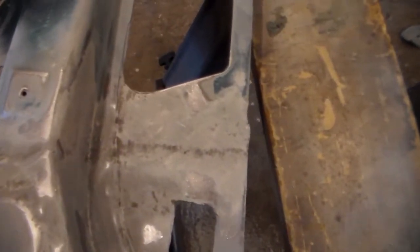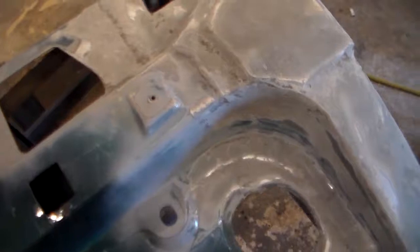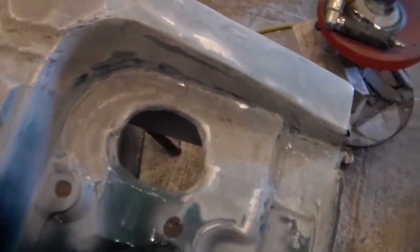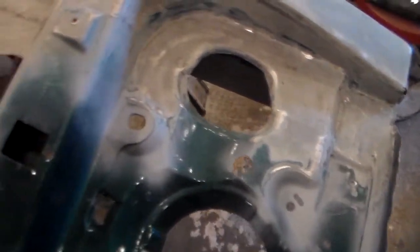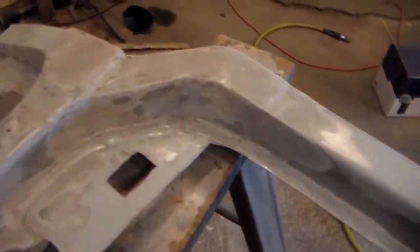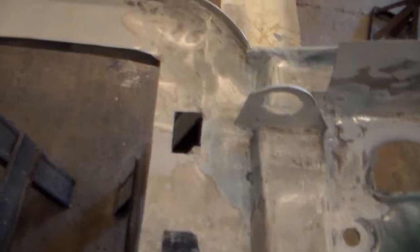This is a good base, a good building block. The next step will be applying run-of-the-mill body filler that everybody's more used to, and that's going to start really making it look nice. But this gives a good base before going to that. If you want to skip this step you can, but it makes a good firm building block to apply the body filler over. Here's a shot of the back edge with the fiberglass sanded — it's a little more time-consuming because of all the tight quarters.